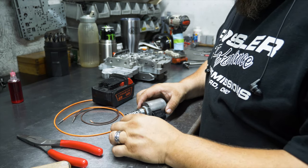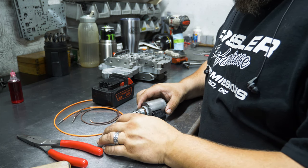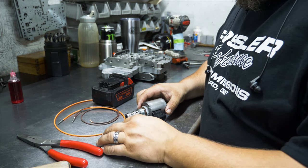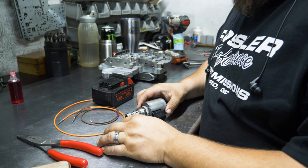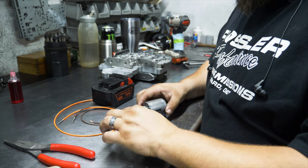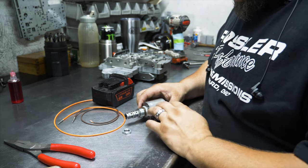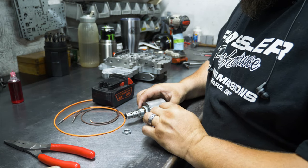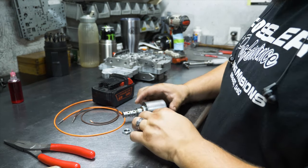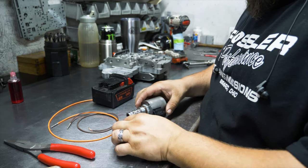So today we did a little bit more testing and we could see the solenoid being commanded come on. And you could see the amperage, but nothing would happen with the pressure. So we decided we had an issue. Talked to Carl a little bit, and he thought that maybe there could be an issue with the valve here in the solenoid. So pulled it apart. I put power to it, and nothing moved.